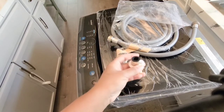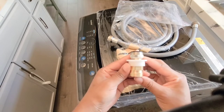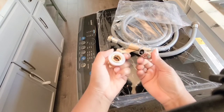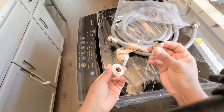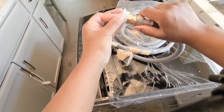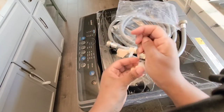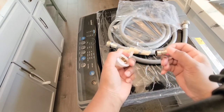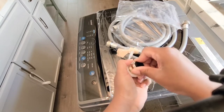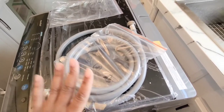With the washing machine you receive a quick-release adapter to help get the hose connection on and off. To use it, push the white part down and pull the connector off. The part that remains goes on the actual faucet, and the other part attaches to the hose. To reconnect, hold the white part down and push the connector back in.